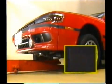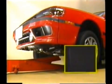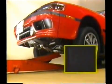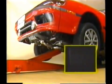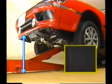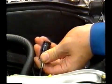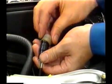3. Repeat this procedure for the front of the vehicle. If there is still no change in the blinking of the warning light, then the deceleration sensor is functioning properly. If there is a malfunction in the deceleration sensor, the pattern of the warning light will change. This finishes the deceleration sensor check. Remove the short pins from the TS connector.